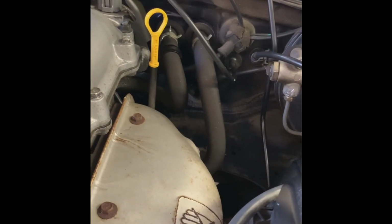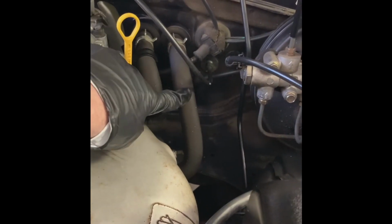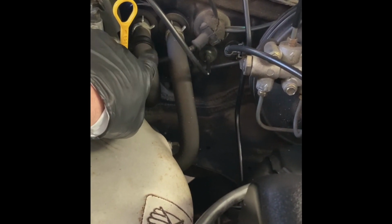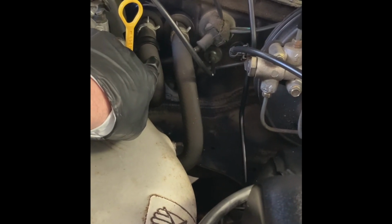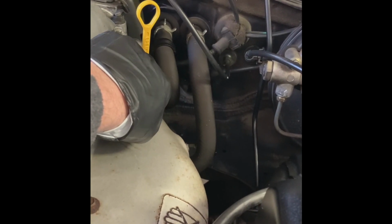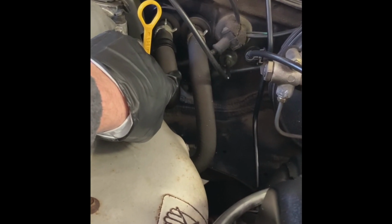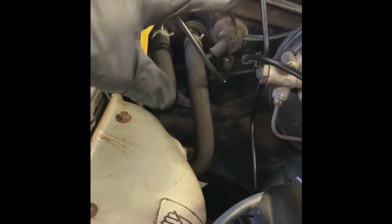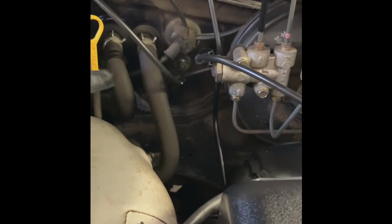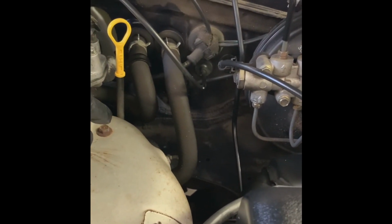Now, two other hoses that have a nasty reputation for being difficult to repair in the cooling system are the infamous heater core lines. This one is actually not considered too difficult to repair or replace. However, this guy is a nightmare, because though it's easy to get to at this end, it has an interesting little kink and then goes up between the engine and the firewall on the back side. There's obviously a lot of material back over here. You've got the booster for the brakes and obviously a whole bunch of other stuff back in there to make things challenging.